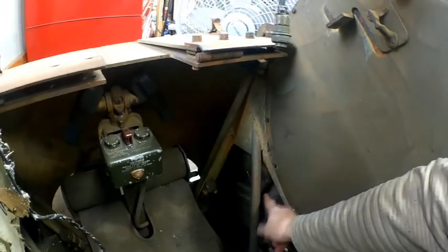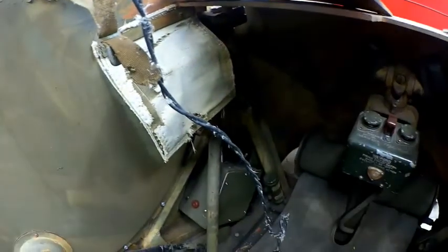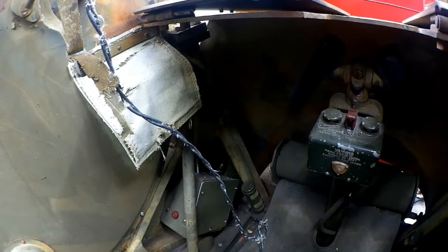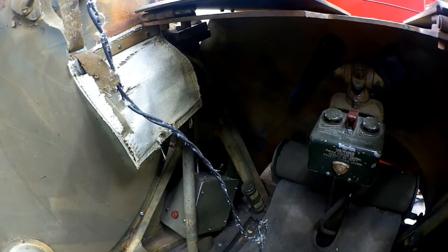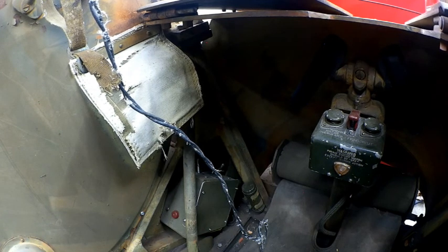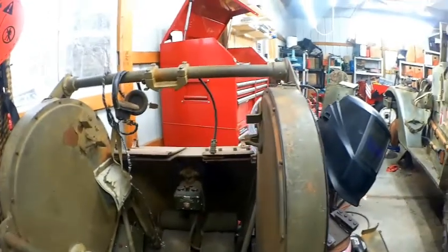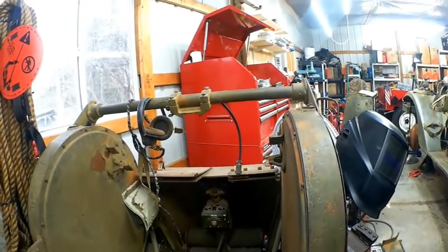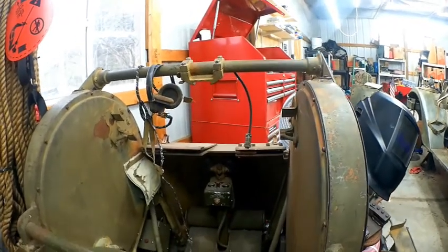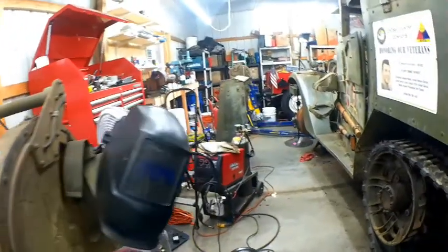All of the turrets have this box here, which is your firing circuit running up to your Cadillac. This is a separate charging circuit. This means I can charge my batteries on my turret here from the half-track generator, or if the half-track generator does not run, for some reason half-track batteries are dead, I can charge the half-track batteries from this switch box here in my generator, which is actually under the cover here. Generator will charge the batteries on the half-track. This was specific to the A2 series of tracks that were sent to Korea. Part of that was due to the environment there, the extreme cold. So they were given an option, which the World War II tracks did not have, the ability to charge the turret batteries from the generator on the half-track.